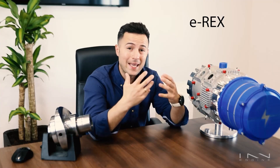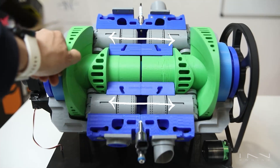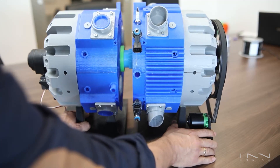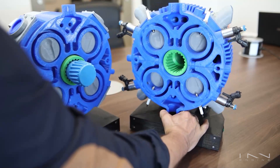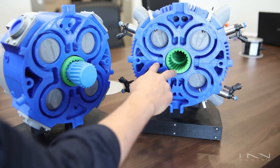Now back to the E-Rex. On the E-Rex, not only do we never have primary imbalance because of the opposed piston configuration — in fact, even if we took the engine and split it in half, each separate half would still be perfectly balanced at all times, with all mass moving in symmetry. To go up, to go down.